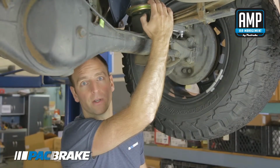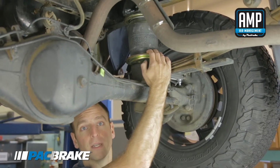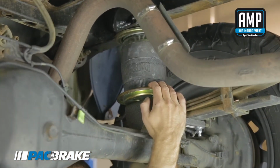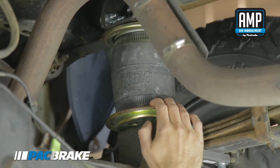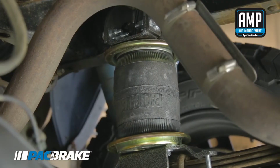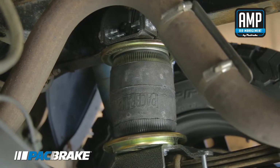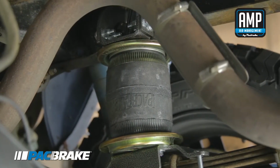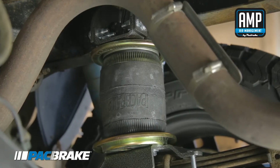This is our existing Toyota Tacoma air spring kit. This kit's great if you're keeping the vehicle on road, pulling your trailer. However, if you are planning on going off-road, it is going to limit your suspension travel, both in compression and extension. For this existing air spring kit, this bag diameter is actually quite wide. This is being ported from 1.5 ton trucks and isn't necessarily the ideal air spring for a light duty vehicle.